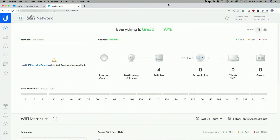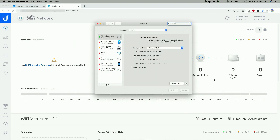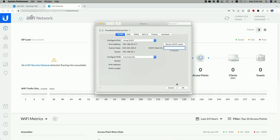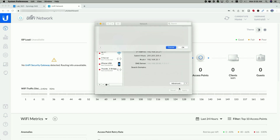The drivers are built right into macOS if you're running version 10.12.6 or newer. Let me bring up the Mac network preferences. You'll see it just shows up under Thunderbolt Slot 1 and shows as connected. What I did do was come over to the hardware section and change the MTU to Jumbo 9000 and apply that — that's the only change I made.